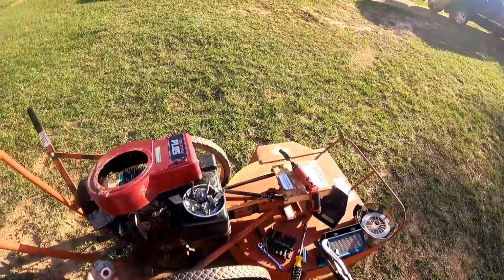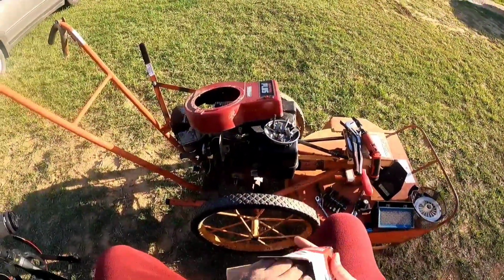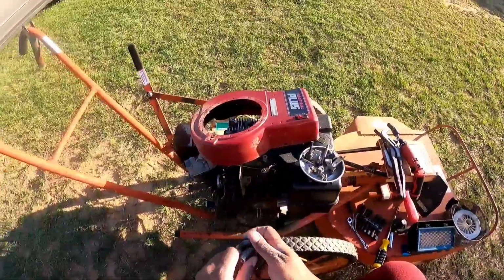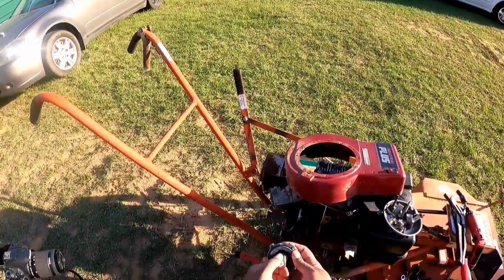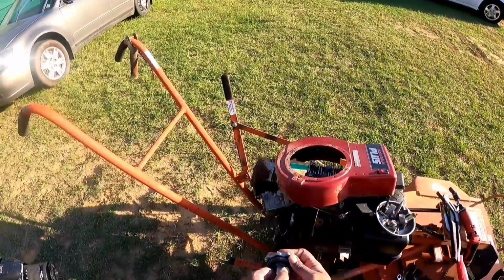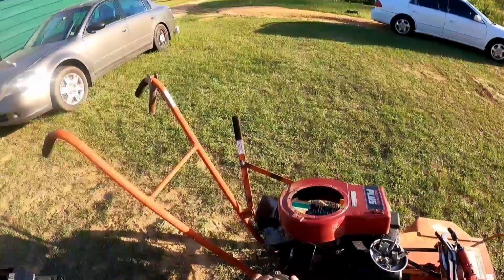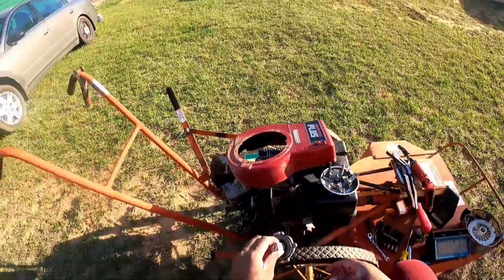It's off. So let me go get my Chinesium one. Here it is. Look at that. See that? That's in cranking motion there. I had these ball bearings in here that's supposed to catch when it goes forward. That's how the clutch part works. And then you can crank it. But this one right here, the old one wasn't working. See that? So that is free spinning going forward. Catch it sometimes. It's bad. Bearings in there are bad.